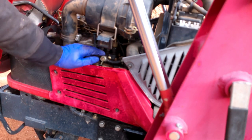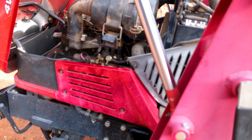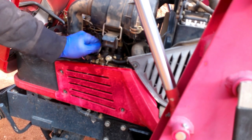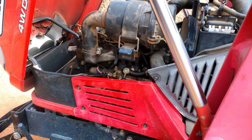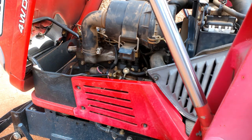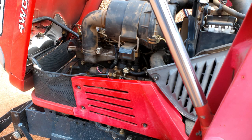You may also go to the injection pump — you might have a bleeder screw on it. You may have a bleeder screw on this little unit here; I can crack open this bolt right here. On other machines you may have a hand pump where you can pump and get air out of your line. If you have an electric fuel pump on your machine such as this one, you might crack your line and turn your key for the electric pump to kick in until you see fuel start pumping through your system. There are several different ways and tricks to get the air out. The most important thing is that air is out of your system for a diesel engine to run correctly.